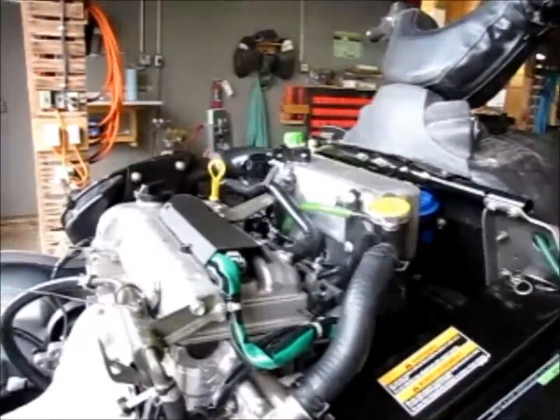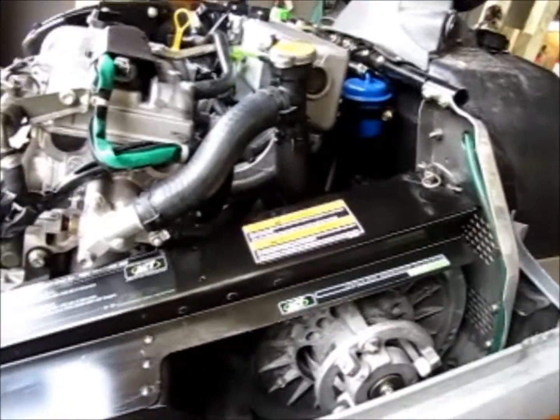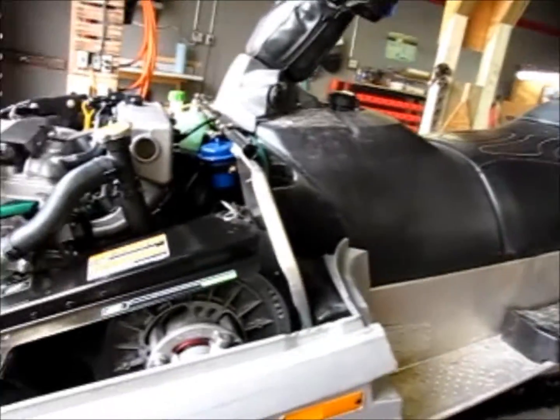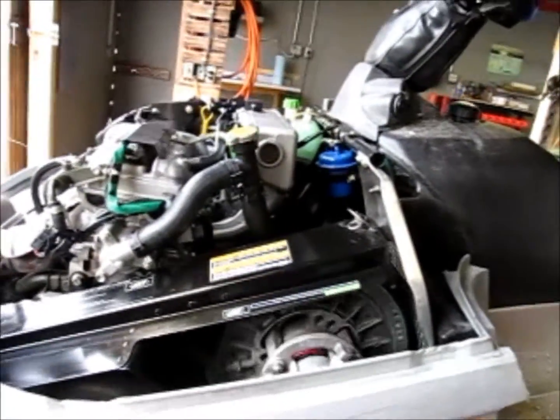Just before I put the cap on I watched the level go down and topped it off, let it go down and top it off, until I got everything back in that I'd taken out. We've got her suspended up on the hoist just enough so the track can turn freely so I don't have to worry about the thing shooting off the trailer. So far she's been running about 10 minutes, I've revved her up quite a bit — definitely up to heat and temperature — and so far we don't have a temp light on, so I think we got her doing pretty good. I'm going to let her run probably another 10 minutes, then I'll let the guy know she's all set. Should be getting some snow in a couple of days so maybe he'll take her out and run her. Thanks for watching.